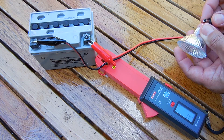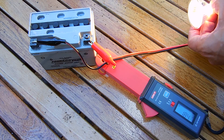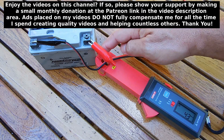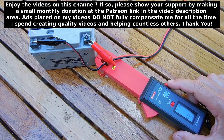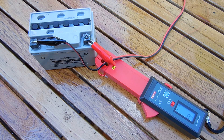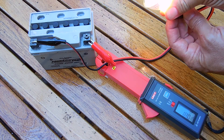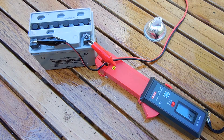Now I'm going to connect up the bulb and you're going to see how much current is flowing through that wire. The more current that flows, you're going to have a stronger field around that wire which shows a higher current. And you can see 1.84 amps. After testing there's 43 milliamps remaining due to residual magnetism left inside that laminated iron core, so before the next reading just zero it out. Then it reads 1.8 amps — the current dropped slightly due to voltage drop on the battery.